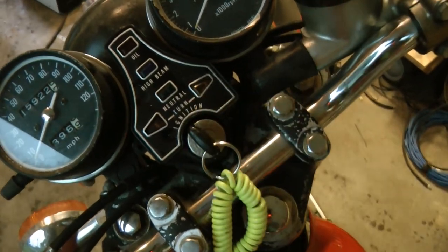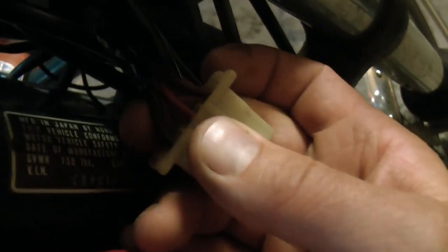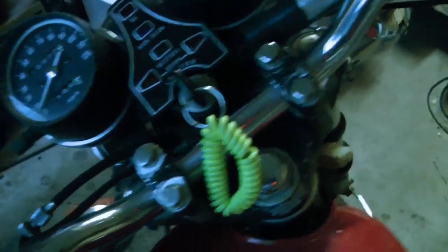There I am in the dark by myself. I reach underneath and find this connector. It's got a little tab underneath — you push that up and then you can pull it out. You can see there are six pins under there. I was pretty sure that the middle one, which is red, was power going into the switch. There are three pins across the bottom and two on the top, but power was coming into the middle.